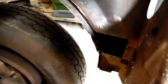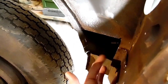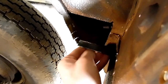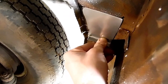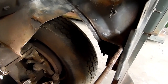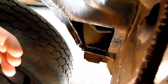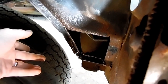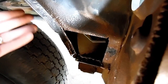It didn't take too long — I went ahead and chopped that out and cut a part of the lip too, because we noticed it was really thin, as well as the piece underneath it. It was just easier to cut out both of them rather than trying to chisel it out. Here's the piece that will go in place of the bottom — we'll fit it in there, it's ready to go. And we've got our little puzzle piece with the lip bent into it, trimmed and ready to go in right there. We'll get that welded in, and we should be ready to start reversing this process. Just getting all this trimmed back in, but I think we're almost there to start reversing everything.